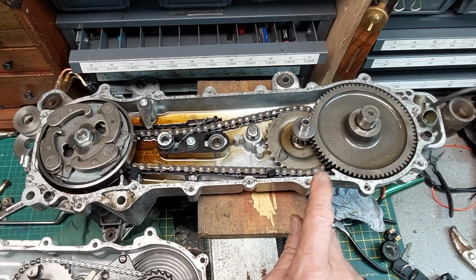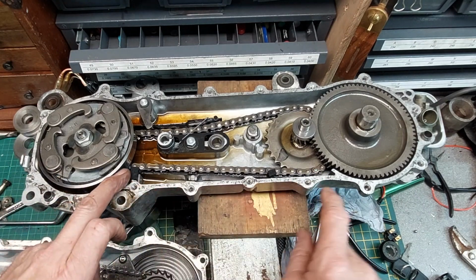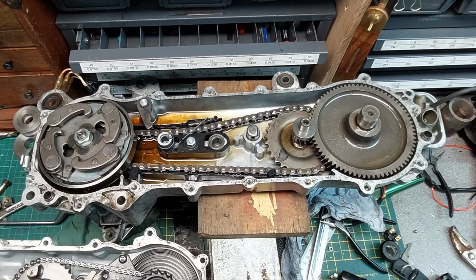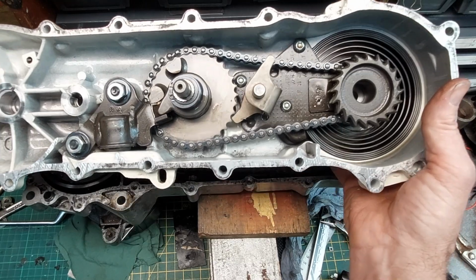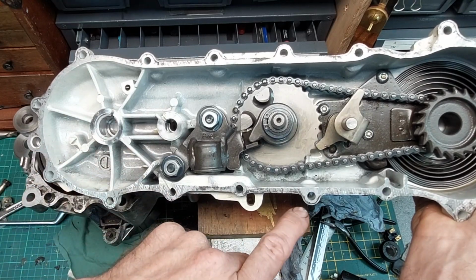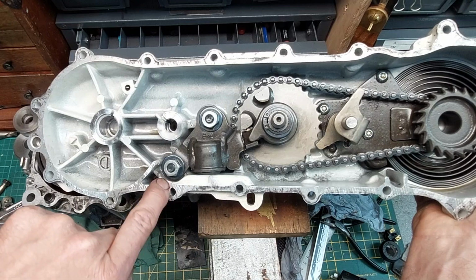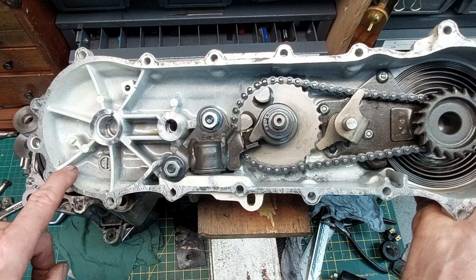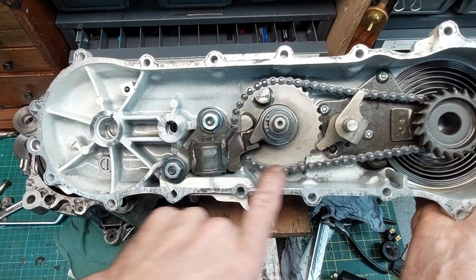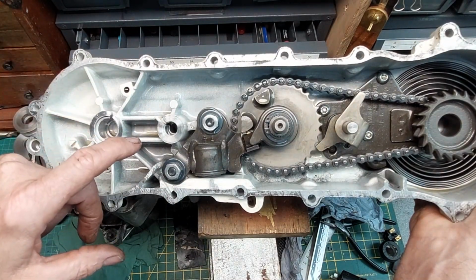Also, when you pull the drain plug out, I found out in the manual, you only get about 0.6 of a litre out, and the reason is because there's this baffling in the bottom. Well, this is lower than the drain point as well, so there'll be oil in here, and oil in here, easier to see on this bit here. You can see the baffle plate here, so there'll be oil sitting in there, and the drain hole is, where's the drain hole? Drain hole's here. See, so you've got a little gallery there for the oil to drain. So you'll have oil sitting here, up to there, oil in there, and along there as well. So if you ever want to do a full oil change, the only way to get it out really is to take the gasket off and drain it out.